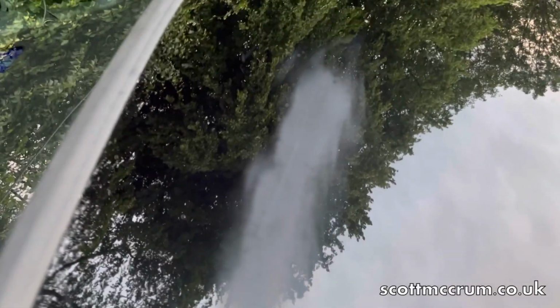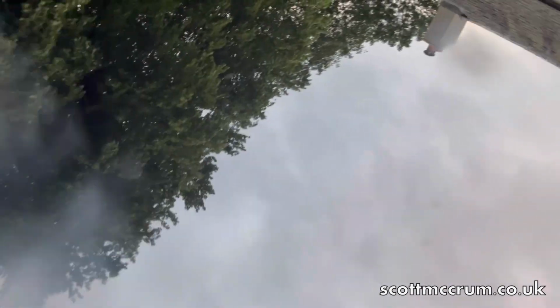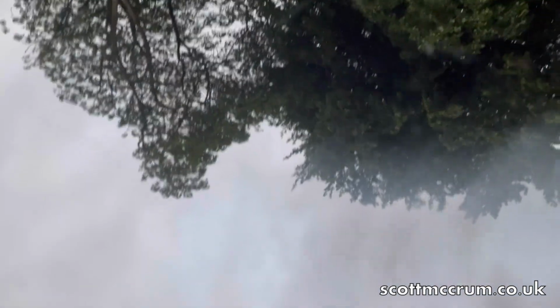After it's all been sanded, there's a scratch there, so I sanded that as well. I actually ended up doing 1500 on these. Can't really see that well. Yeah, 1500, then 2000, and then 3000, to smooth it all out. So there's quite a few over there. Again, it's hard to see because the car's sitting in the light, but you get the gist. So we'll get these cut and polished.